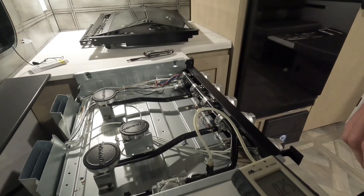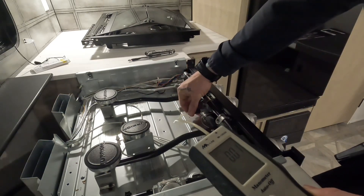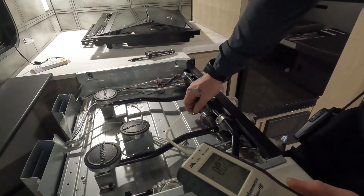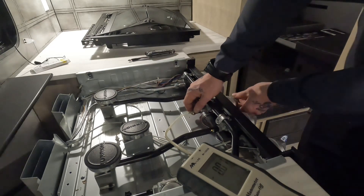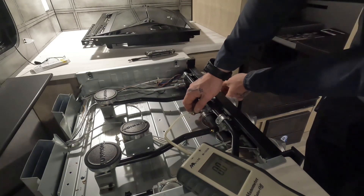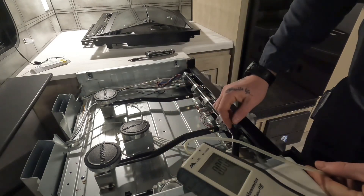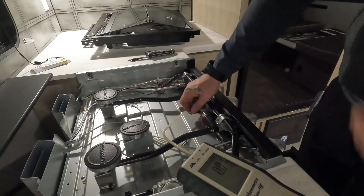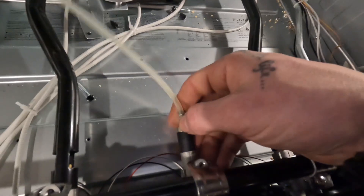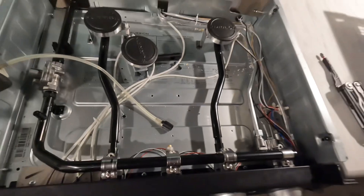For those of you who do not have this fancy test port, the other way — which is the more common method — would be connecting the manometer to where we removed the burner from. You're going to connect it onto that orifice, open the corresponding valve, and then do the same exact thing, bleeding pressure out on an opposite burner. Pretty much just treat the burner orifice just like you would the test port and connect your manometer there. On stoves that do have the test port, I wouldn't try to use the orifice because the shape doesn't take the adapter well for the drop test.